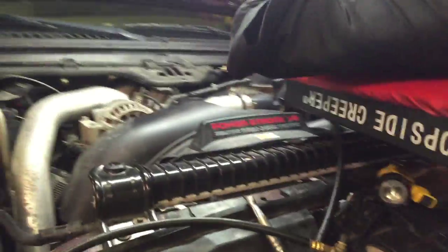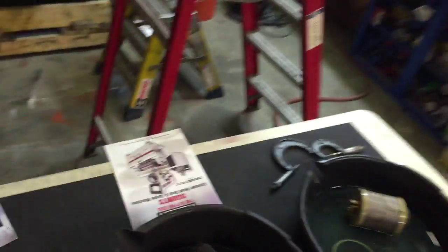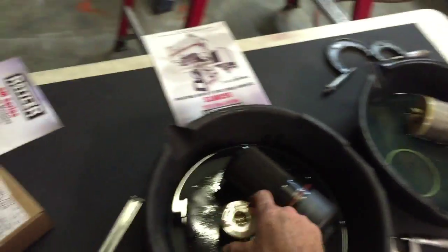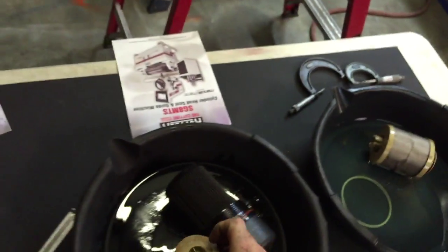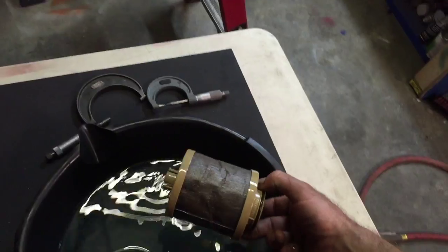We did have a dry oil filter — we had oil pressure issues. It had a Wix filter on it. I took the filter out and it was completely bone dry, not dripping at all. Fuel filter — no way. Anytime your fuel filter is stained on top, I'm like okay, replace it. It shouldn't be in long enough to get stained.